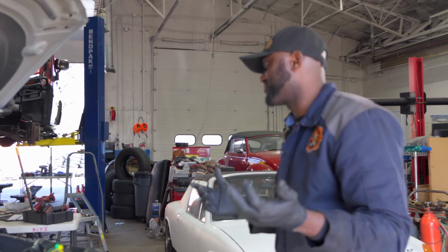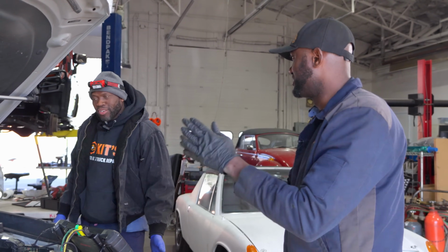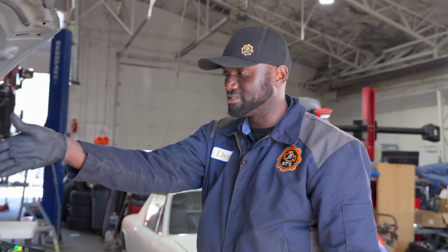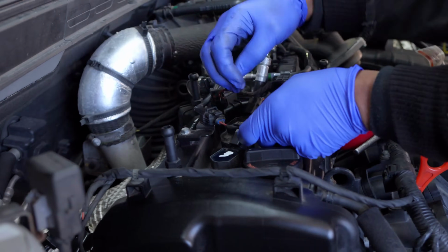Now, Robin, just for fun, would you like to remove a spark plug from a good cylinder? Yes, sir. No problem. Maybe let's take either the 1st coil or the 2nd coil out too. Let's put a compression gauge on a different cylinder to see what kind of readings we're going to have.